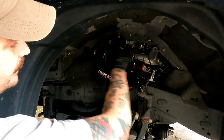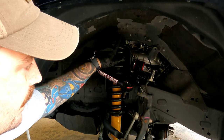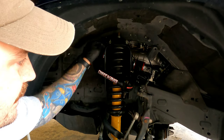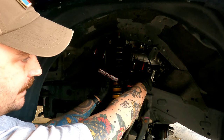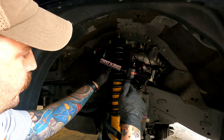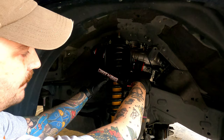Now that we've got the bolt through and the factory bolt and nut installed, you can see the washers go on each side — outside of the bushing to the inside of the shock tower on both sides — with the factory OEM nut on the outside. We put grease between each bushing and washer as stated in the directions. We'll torque the main bolt down to 85 foot-pounds. Before that, we'll install the ball joint into the spindle with the new castle nut and cotter pin, then torque both: 85 foot-pounds for the main bolt and approximately 80-81 foot-pounds for the castle nut.